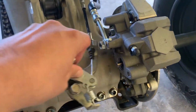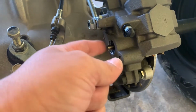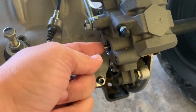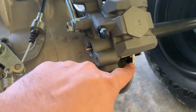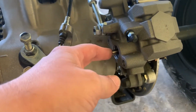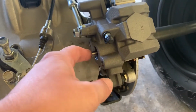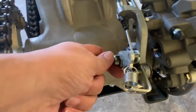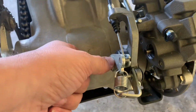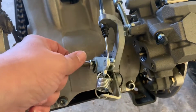As you can see, basically what it does when you push the lever, it pushes into your brake caliper and then into your brake pad. So that's how it holds your disc rotor and creates the parking brake. The problem with this whole setup is that this way your brake pad wears out, so you have to be constantly adjusting with this nut here. You've got to loosen this part and be constantly adjusting if you want to keep on using your park brake.